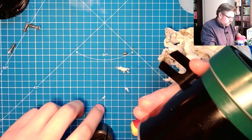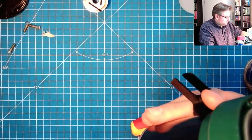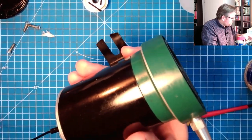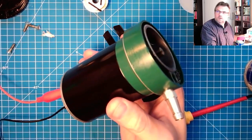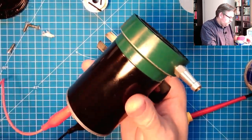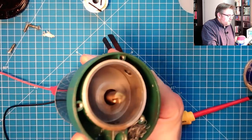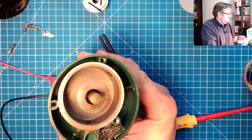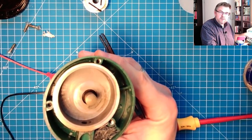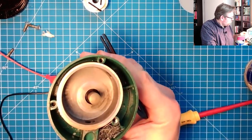So now there should simply be no difficulties at all. Let's see if this is now working. I have too little power, but you know, I already operate this in bridged mode. This voltage source, this power source, should deliver 6 amps at 12 volts, so this would be 60 watts or 72 watts. Now it's working. Now it's only taking 1.7 ampere at 12, so the motor seems to be fine. Good.